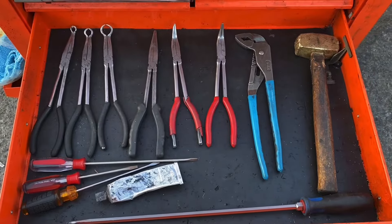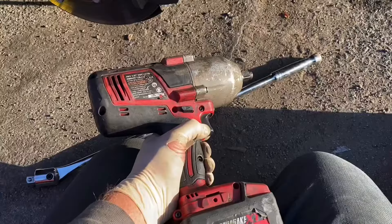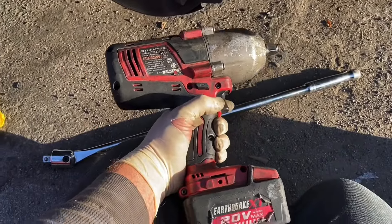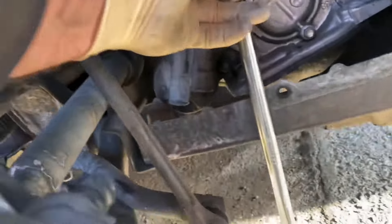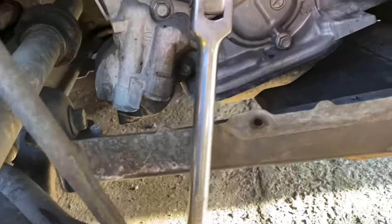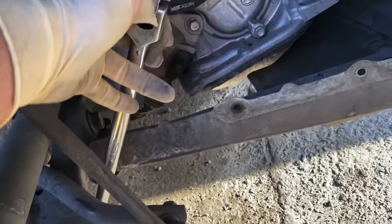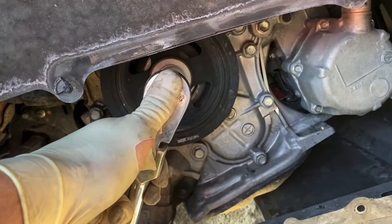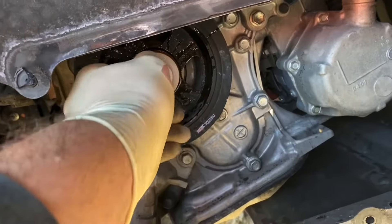Look for these tools. Jack up your Prius, remove the wheel. Normally we would use the impact gun to remove the harmonic balancer, but we understand not everybody has one of these. So we're gonna use a half-inch ratchet, 19 millimeter socket. Place it on, put it on reverse so we're spinning it back, wedge it up against that, and have our good friend Jack crank it — just a brief crank. That's it, now that bolt is reversed.